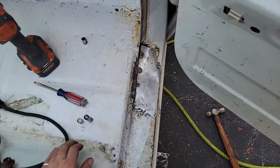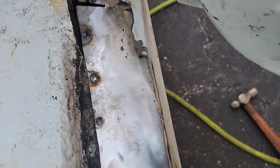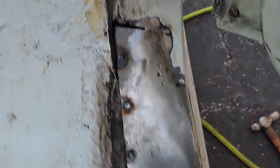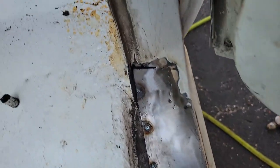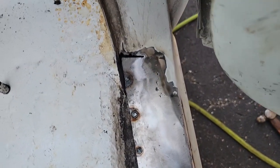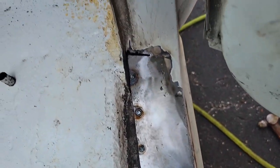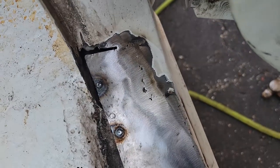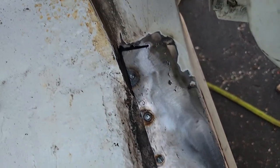First pass — got the finish there, a couple little spots. The rust is blown out as I'm welding, but I'll be able to build up and grind back. Way better than it was. Just take your time, finagle it. I'm no pro, no expert, no master welder, but for a patina vehicle this is better than a big hole. If you see a little bit of it after I paint over it, so what. Then I've still got to build this piece here yet.